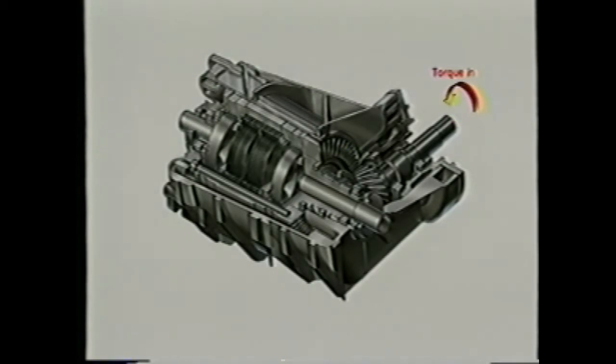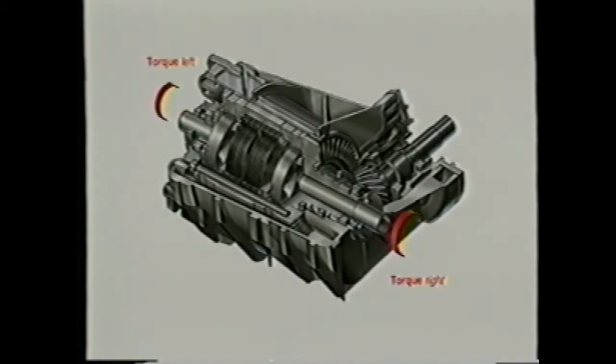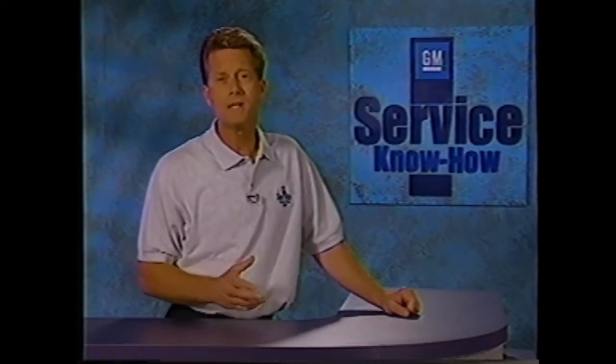When front wheel slippage occurs, a rotational speed difference occurs between the gerotor pump components in the differential carrier assembly. The pump draws fluid from the sump and sends fluid to the pistons, which actuates each specific rear wheel clutch pack. If a temporary spare or any wheel of a smaller or larger dimension is used, the wheel rotational speed difference will be detected by the wheel speed sensors of the ABS system. The EBTCM will close the differential check valve to block oil flow to the gerotor pumps. In both spare wheel usage and over temperature conditions, the check valve will actuate, blocking oil flow and illuminating the AWD disable lamp on the instrument panel.